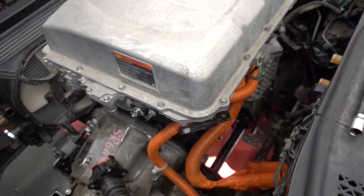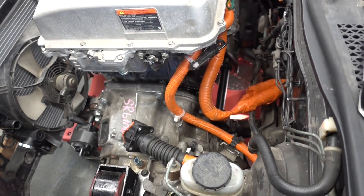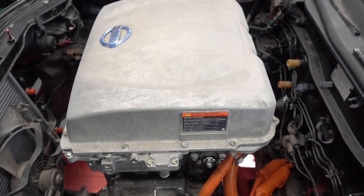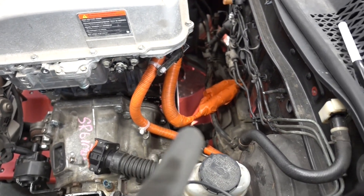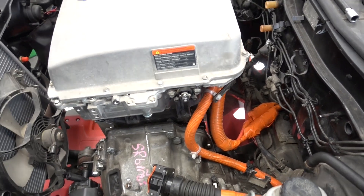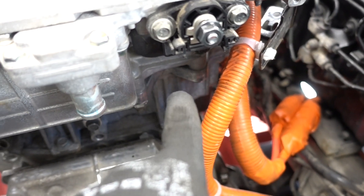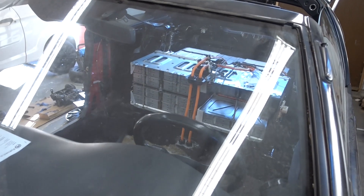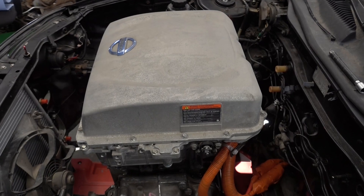The PDM is in place and we have hooked up all the orange high-voltage cabling. The charging port is also here — just lying here for testing — we will extend the cable and put it in the back where the fuel flap used to be later on. We've sealed everything up and it's ready for testing. We also did checks with the multimeter to confirm positive and negative are on the right sides. Pro tip: the positive cable connects on the right side and negative on the left side — this is also in the manual for the Resolve EV controller. We verified polarity by running the multimeter back to the battery.